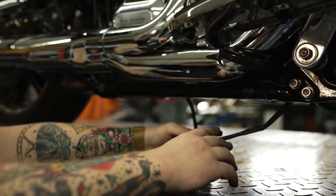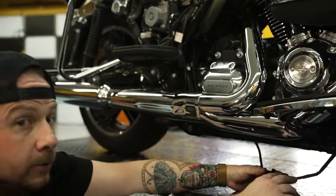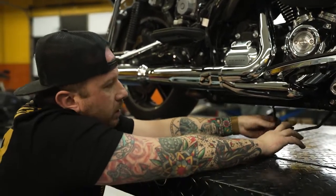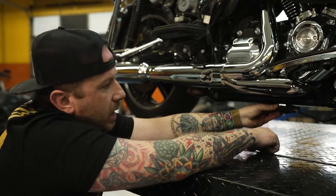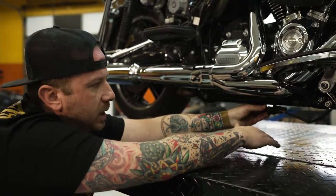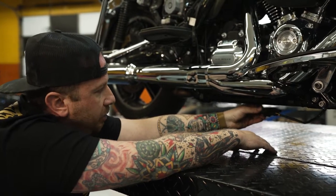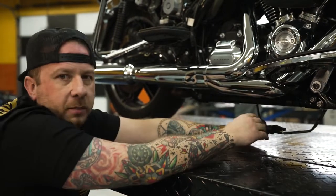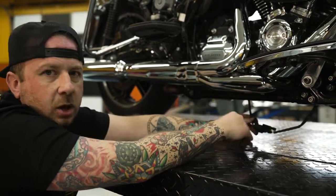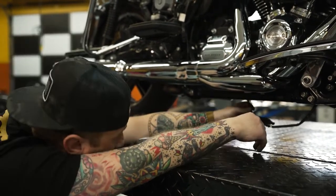Now, something to keep in mind when you're working down here like this, you have two things that you want to kind of steer clear of. One is having your O2 sensor hang down too low on your frame rail. Guys, you're going to hit it, curbs, things like that. And then the other thing is you want to make sure that you stay away from this exhaust, okay? You don't want this wire laying up against the exhaust, getting burnt and arcing out and causing some damage somewhere.